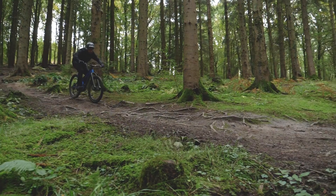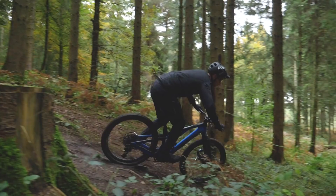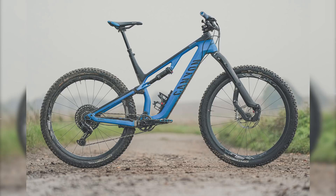The biggest thing I didn't get on with on that fork was the fact I couldn't put a mudguard on it — that's a huge problem here in the UK. Trying to ride in horrible wet conditions without getting a face full of mud is a bit of a problem. That aside, I've really learned to quite like that fork. It's on my Canyon Neuron and it works great. It makes the bike feel a bit longer, and the effect is you don't increase your head angle or decrease your trail — the bike actually gets more stable as it compresses.